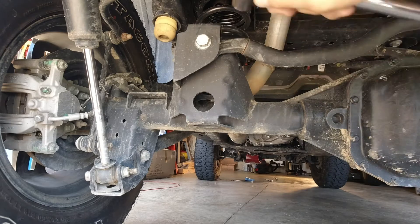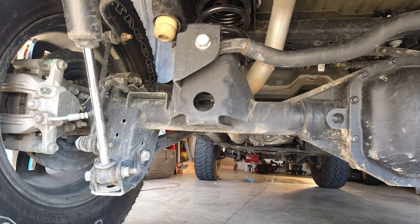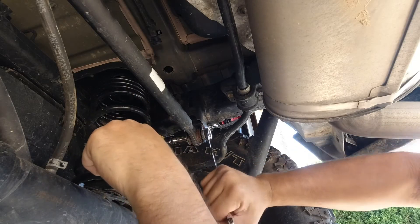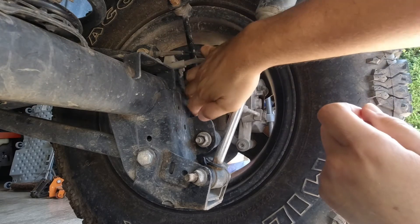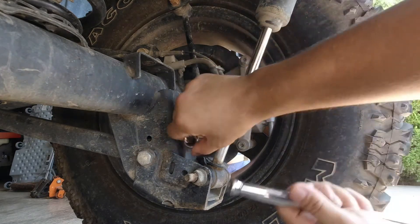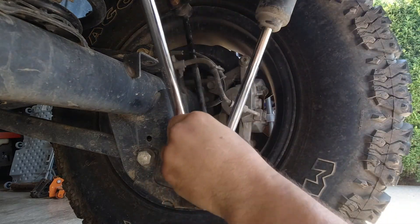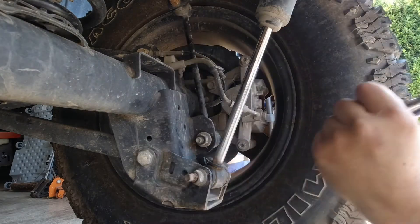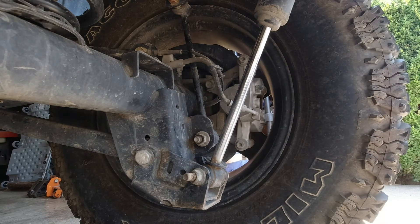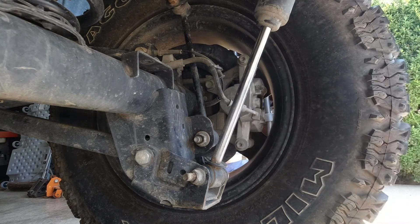Some of these are flagged on the back side. Don't forget about your rear sway bar drag links — they're different sizes for top and bottom: 18s on the bottom and 19s on the top. Just go through and snug those up on the bottom, then the top one at 19 millimeter — give that a snug. Do that on both sides because you have two.